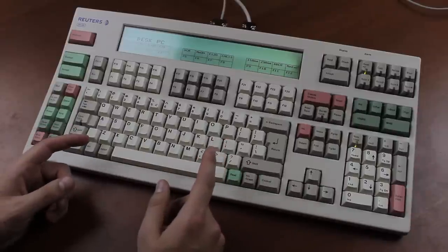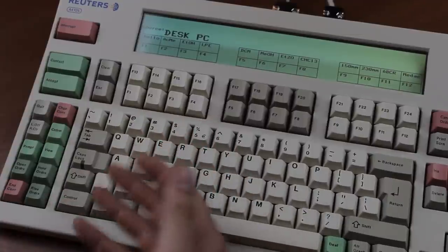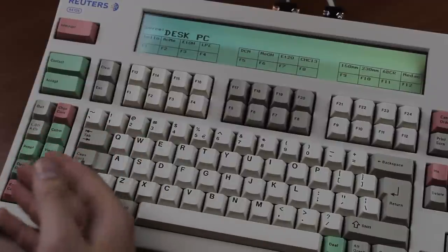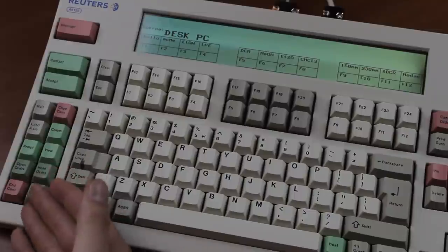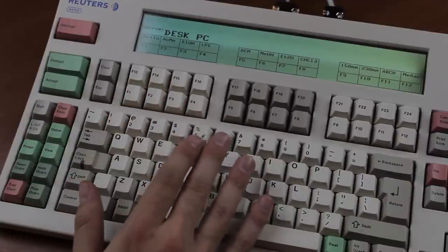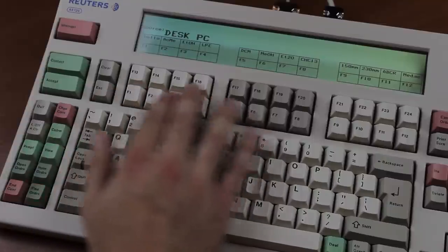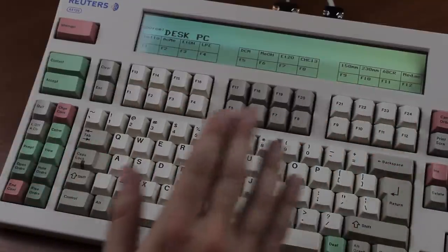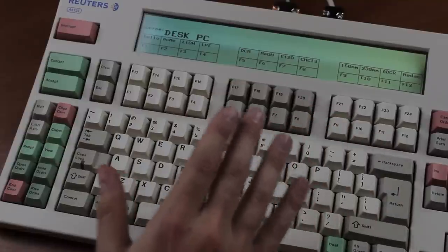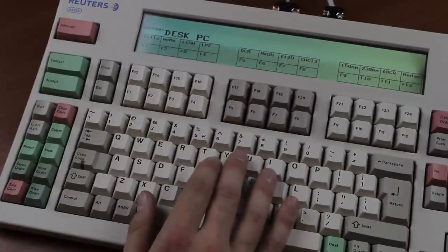definitely an exception. The keyboard doesn't have all the functions it would have if it were wired up through the original box, but there is still a good amount that it can do. The special trading keys don't register any scan codes that PS2 can understand, so without the box I don't think they can be reprogrammed computer side, but keyboard side it has 12 programmable macro keys that can hold up to 80 characters each, which is F13 to F24. And the Control and Shift keys, plus F13 to F24, can be used to program additional macros, so in total that's 36 programmable function keys.